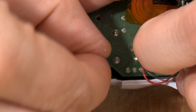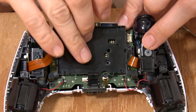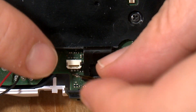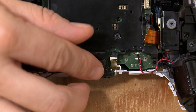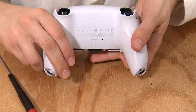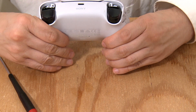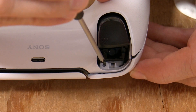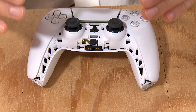Put all the cables back into place. Put the battery case back on. Put the screw back into the battery case. Put the ribbon cable to the rear microphone back in. Put the microphone back into its slot at the bottom of the battery case. Plug the battery back in and put the back half of the housing on. Put the screws back in place at the bottom and at the top. Pop the R1 and L1 triggers back into place. Put this black piece back on.